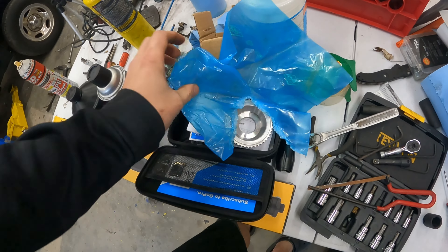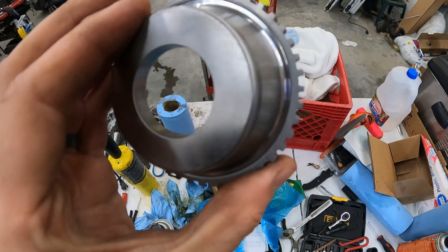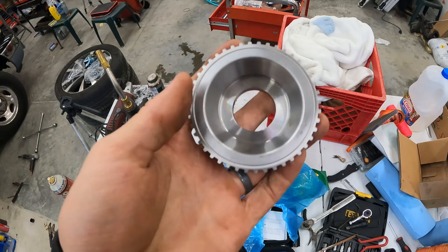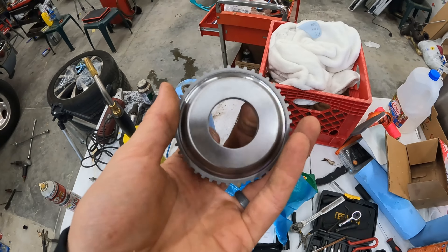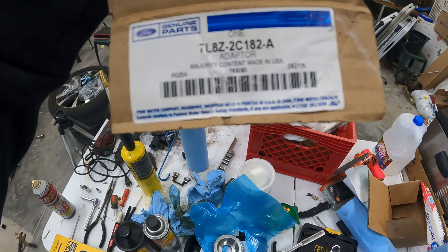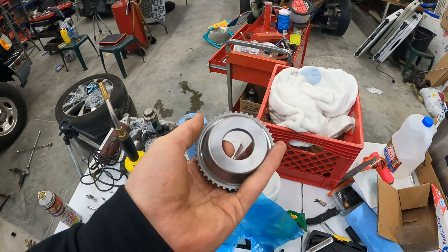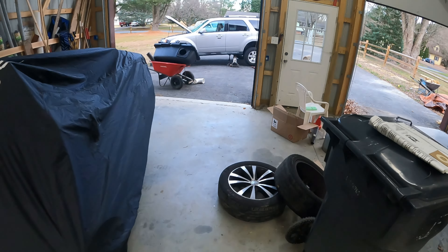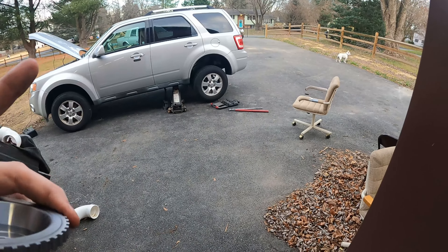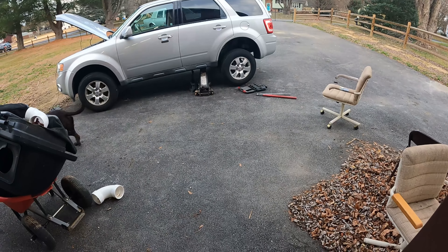Let's take a look at our new part. If you notice there's a ridge between the tone ring and the hold-down, that's because there are two different parts — that actually allowed it to throw this piece. If they molded it from one piece, it probably wouldn't have broken, but we're in the rust belt here so it's going to be a problem. We did get this from Ford and the Ford part number is 7L8Z-2C182-A. There might be a superseded part to this — it's a Ford genuine part. I'm going to set the car back down on the ground so the back wheel is touching when I use the breaker bar, so I can loosen the 32 millimeter nut. It's all connected to the hub, so I'm going to be aware of what's going on there.